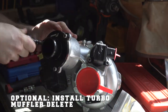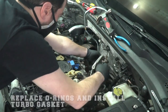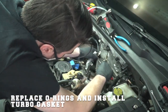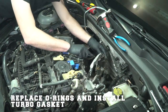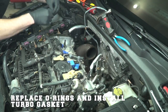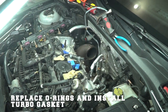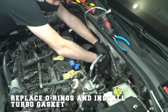This is an optional step: I purchased a Racing Line turbo muffler delete, so here I am installing that and getting it in place on the IS38. Now that you have all these exposed oil and coolant lines, it's time to replace each of the O-rings that will be connecting to your new IS38. If you purchased a turbo kit, you probably received O-rings for all connections, including the connections going into the block.